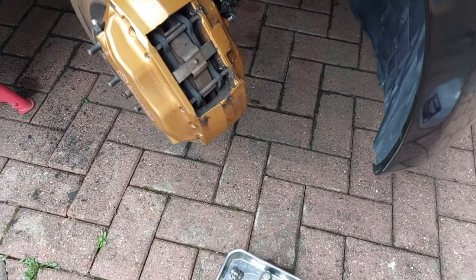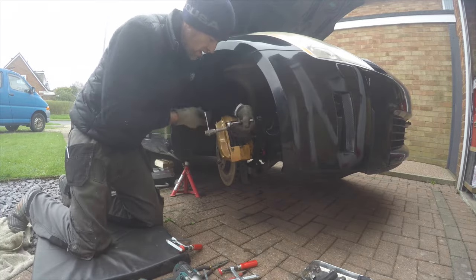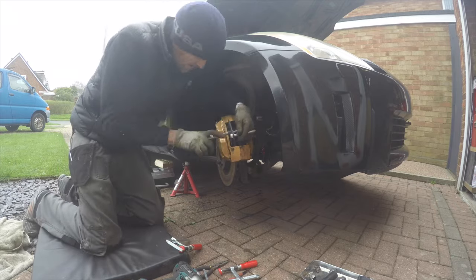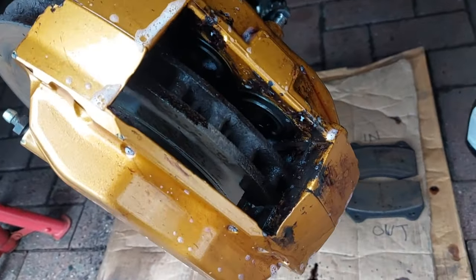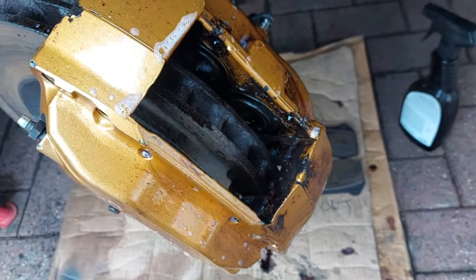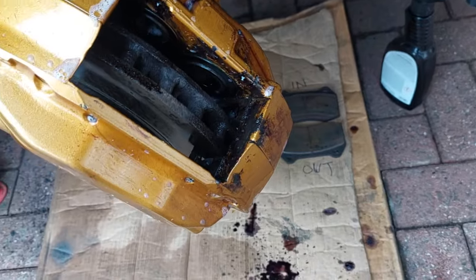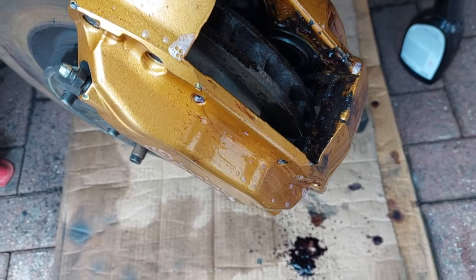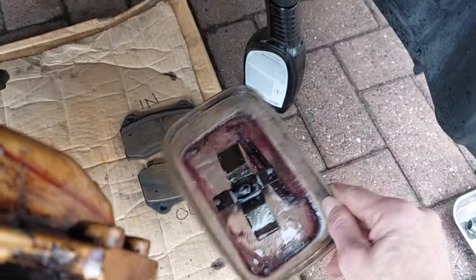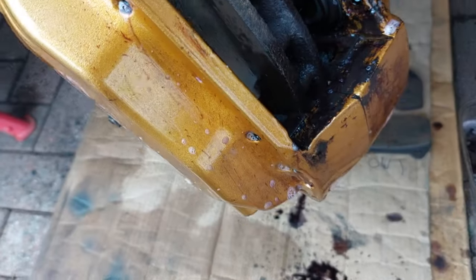I've got the pads out and used this tool to compress the pistons back in, which has made the reservoir level come right up. I changed the brake fluid beforehand because I knew there'd be too much in there, so I'm pushing it backwards and forwards through the system to hopefully get rid of any last drops of air. I've put all the retaining clips to soak in the iron remover - you can see that pinky colour as it dissolves the old steel - and given the caliper a spray too.